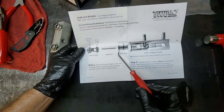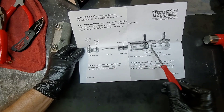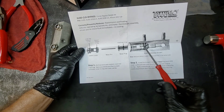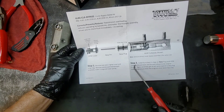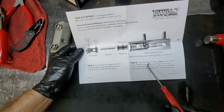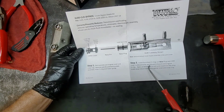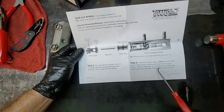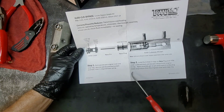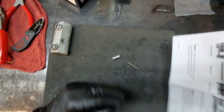When you get rid of this thermostatic assembly, you fill the transmission up and it's already full — you don't have to wait for it to open up and fill your torque converter. The instructions say: save the original cover and snap ring, remove and discard the thermostatic assembly, inner o-ring, and lower spring. Then in step two, install the furnished o-rings on the new plug and OEM cover.